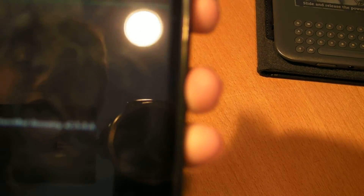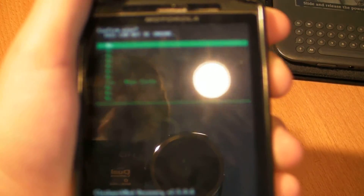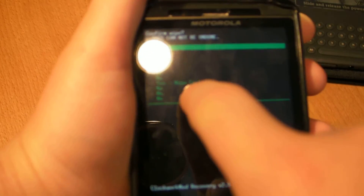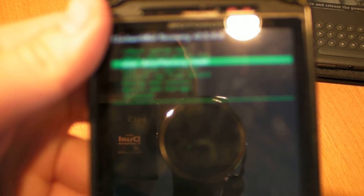To install the Apex ROM, you first have to wipe your cache partition. Press the camera button, scroll through the options — there are a bunch of No's and then one Yes, which is the one with the extra letters. That will wipe your cache. Then scroll down and do Wipe Data / Factory Reset, which is the third one down. Press the camera button and do the same thing.